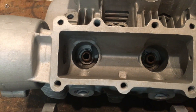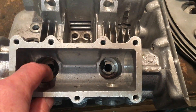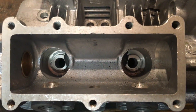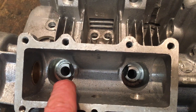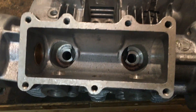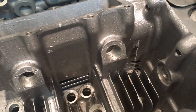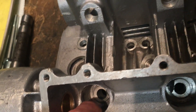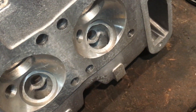The more you look at this, it just makes you think these are possibly machined. Certainly the base for the washers that act as the valve spring seats have been machined - just trying to see what sort of machine marks are on those. Definitely smoother - maybe they have been machined. But anyway, we can check that out. Certainly we haven't got valve seats so they need doing, and when you look at the valve guide holes they said they haven't been machined.